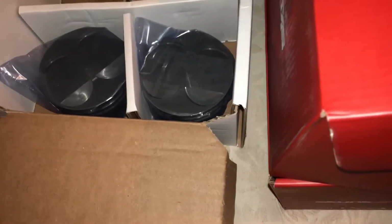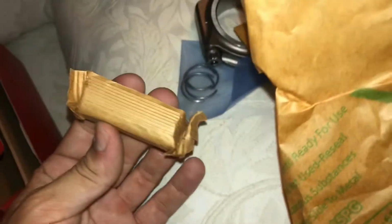My other rod is right here. So there's our new rod, then our other two pistons. We got to put them all together. Got our C-clips over here and our wrist pins right there. So there's two more to go. The rings, wherever they have gone, my piston rings, here they are. Piston rings are gapped. I got 19 thousandths on the first ring, 21 thousandths on the second ring. The oil control ring is not gapped.